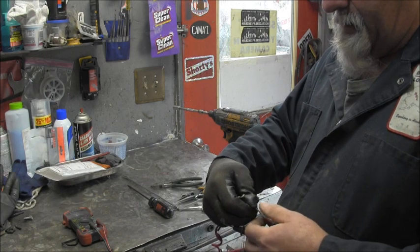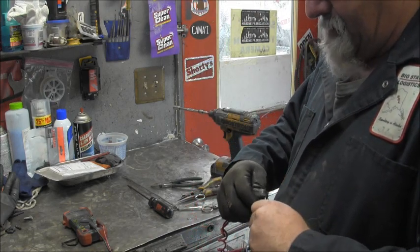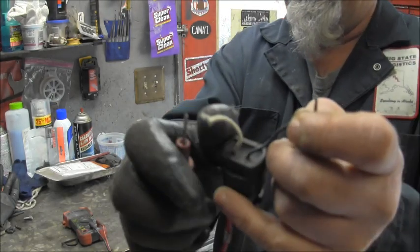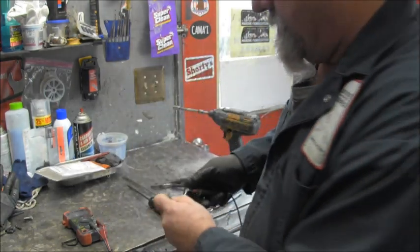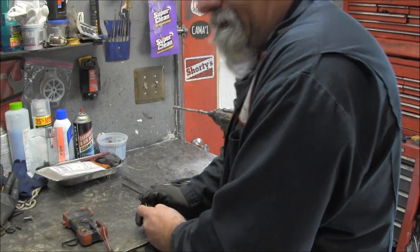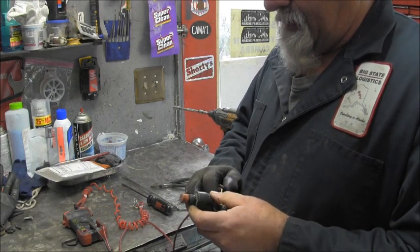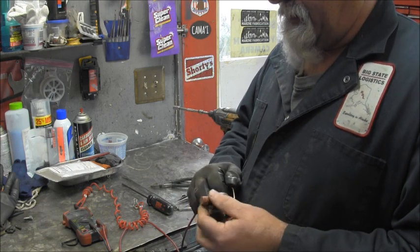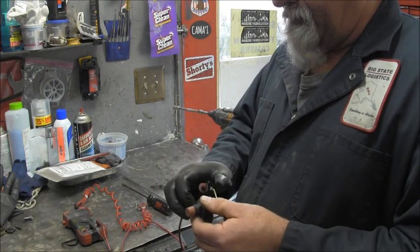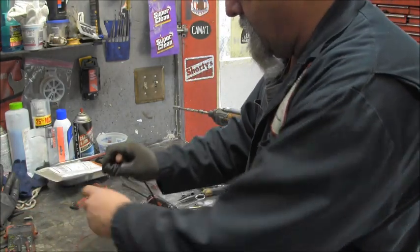And let me wrap one wire around there. Okay. And that didn't work. Try again. Guess I gotta keep a finger on it. Okay. There's one. And there's the other. And I got nothing. No beep. But now if I push it or pull the man overboard clip, if I push it, it works. Now I should be able to pull that and get a beep. And I'm not. There. Just a little spring needs a little work, I guess. There we go. So I'll squirt a little rubbing alcohol on that, make sure it's good and freed up. But this one will work.